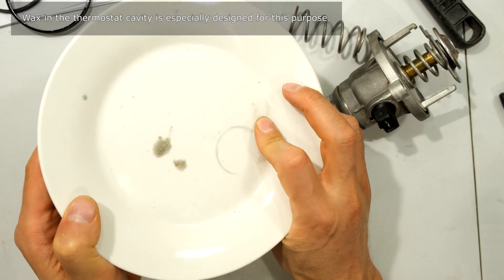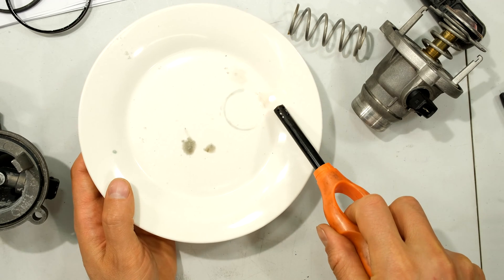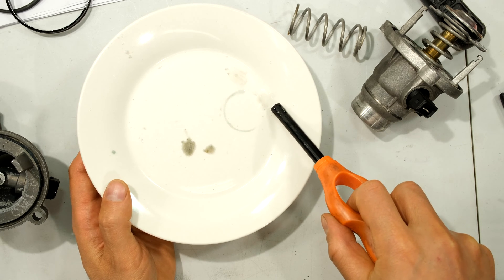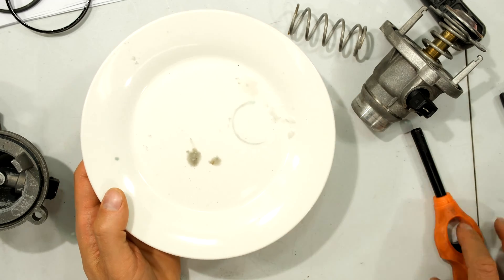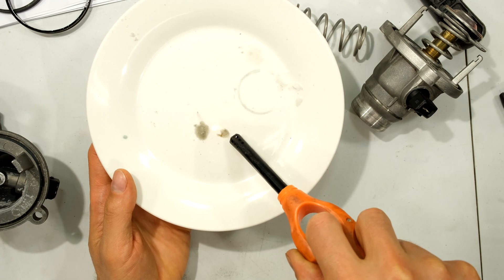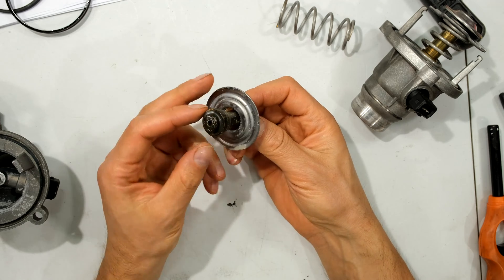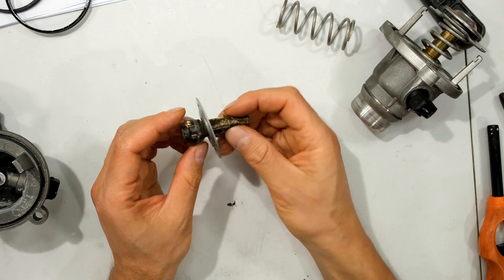The other option is to add more wax, but this is not simply candle wax — candle wax is different. Here's my test with candle wax: it's very sticky, while this is the wax from inside the thermostat. If I heat the candle wax up you'll see it's very runny — even at 75 degrees it starts to soften, by 85 degrees it's melting. The wax from inside the thermostat sticks together a lot more and is hardly runny at all. So if you could get some of this wax you could add a little bit and test at what temperature the thermostat now opens.